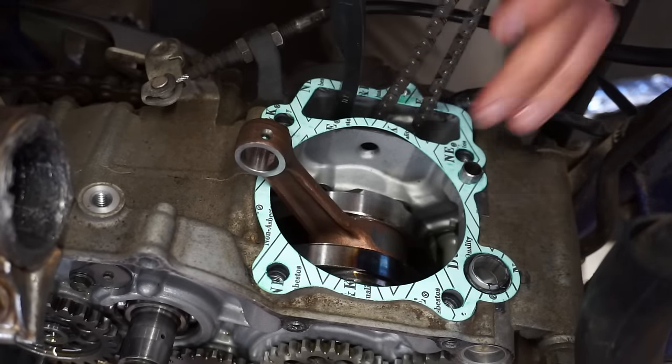No go. We gotta see if this thing's sparking. All right, I just assumed this was sparking. I can't remember if we checked it last time. I don't think we did because we couldn't turn it over. But now we can check it and see if it is sparking. Does not sound like it. Plug doesn't look that wet. Now we're getting fuel. See if you guys can see the spark. Good spark. So that is not the problem.